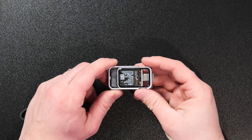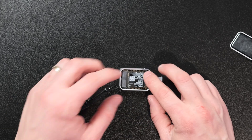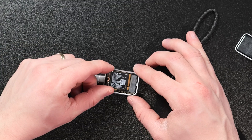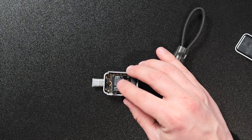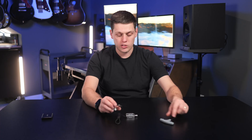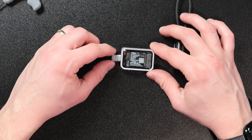I've been testing it out using the Crucial P310-2230 SSD. You will need to have these smaller 2230 size SSDs, but it just uses M2 slots, so it's very easy to set these up. All you have to do is insert the SSD at an angle and then move the little rubber stopper out of the way as you press down — the stopper is going to hold it in place. Then all you have to do is slide the cover back on top of it.